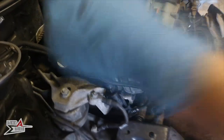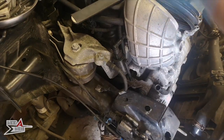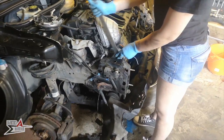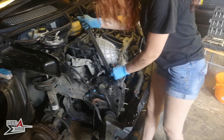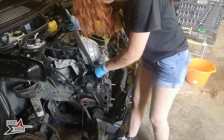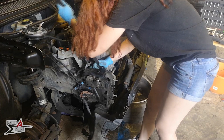My aim at this point is to remove the auxiliary belt and to jam in the little tensioner holder peg thing. But to get to that stage you need to remove the dipstick and then disconnect the evaporation canister. Then you need to pick up the hockey stick tool and honestly make it look like the most difficult task in the whole of mankind. I think it was because I found it difficult to keep the tension and stick the thing in a gap that I could barely see through, so I did have help on this one.